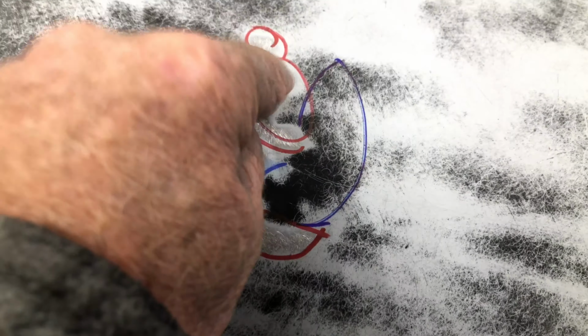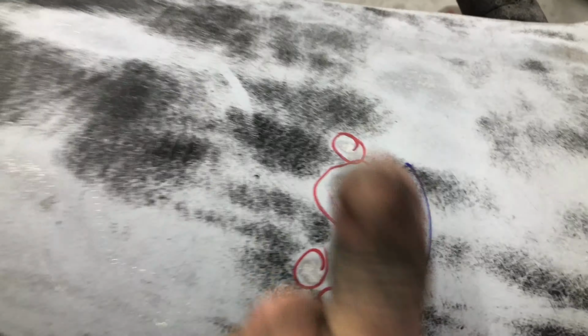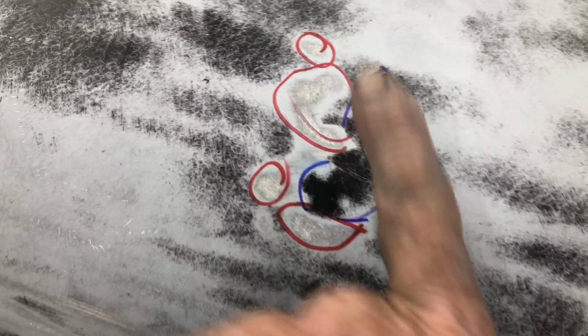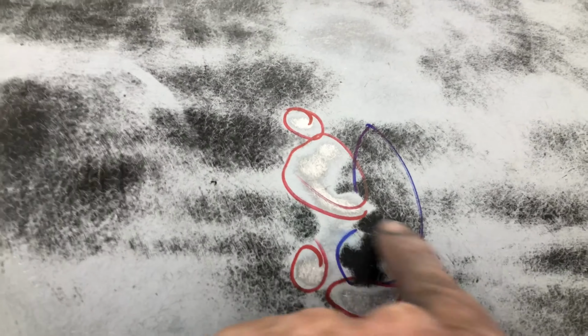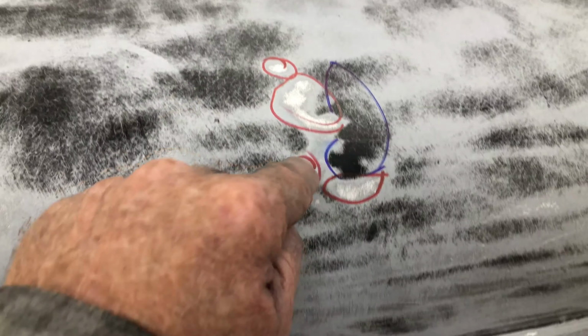Sometimes if something gets hit from underneath, the metal here would go up into that and create a low, if you know what I mean. So these feel low, but when these highs go down, I'm going to hammer and dolly all these down. This should flatten out somewhat. I'm going to put some filler here anyway. I'm not scared to put anything on there. It'll be just a skim to smooth it out. But first, I'm going to go ahead and tap all these down.